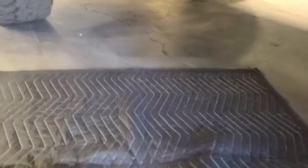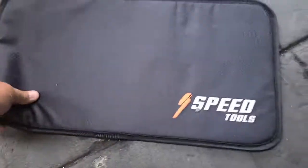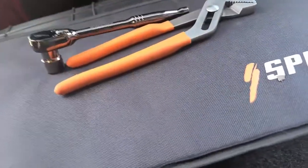So basically the first step here is going to get the stock exhaust off. And to do that, we've got to loosen up. There's only 2 bolts on the bottom. And I'll get everything laid out underneath here. And we'll use those 15 millimeters to get that off. A little bit of lubricant here, and we should be good to go.